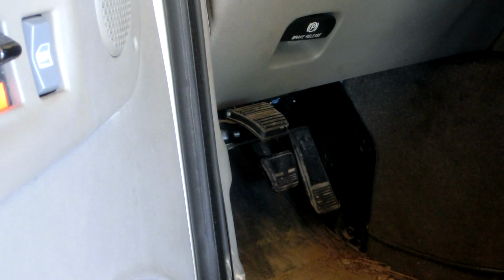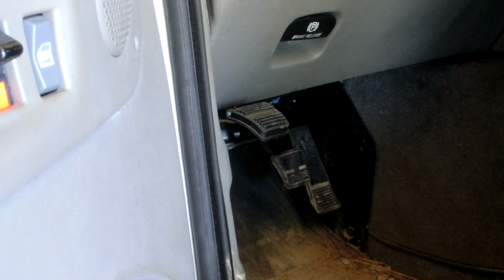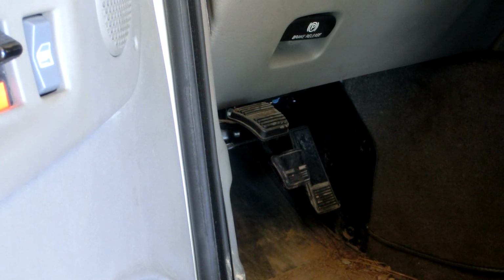Push it down. To the floor? Yep. And hold it. Okay, I tightened it. Let it up. It's slowly coming up. Push it down. Here we go. Let it up. Is it up? Almost. Up. Push it down. Let it up. It's up. Now, pump the pedal until it feels good and tight. And then hold steady pressure. Okay. Is it going down now? Yep. Sunk to the floor. Let it up. This side here's done, Kyle. Great. Clear fluid was coming out? It looks pretty clean. Let me do it some more. Okay.